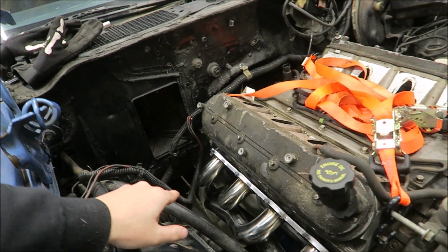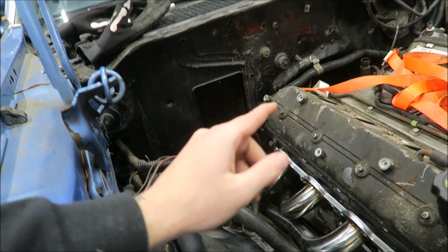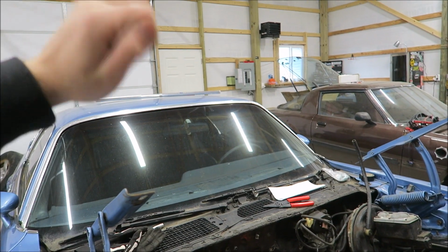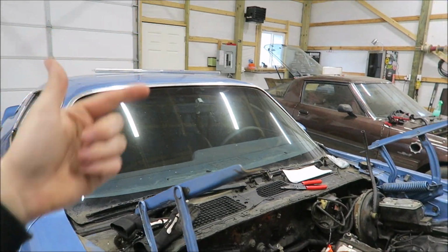And these, I don't know if you can tell, but the O2 sensor bungs are tilted in, because the ones on the Pacesetters go right up into the floor. I had to bang a bunch of the floor in, and when we were down in Texas, we actually couldn't get the sensor out, so we had to just leave that one in and weld in a new bung.